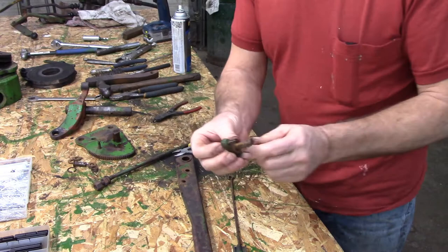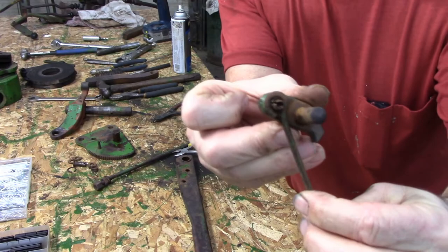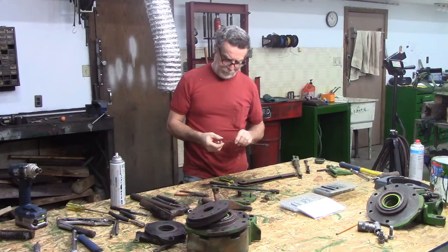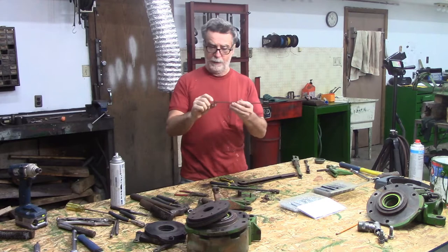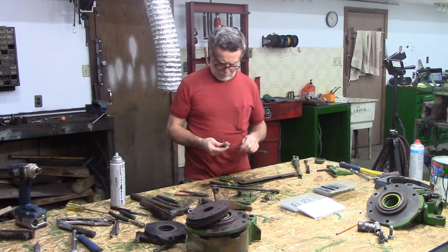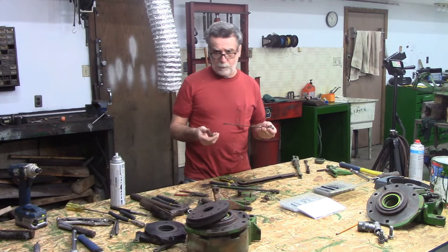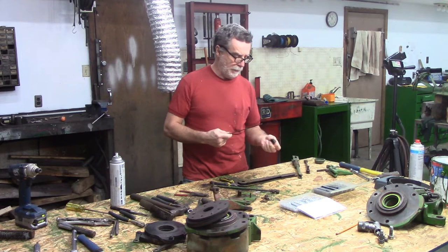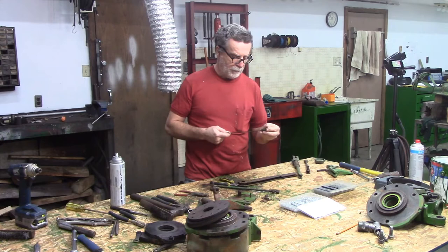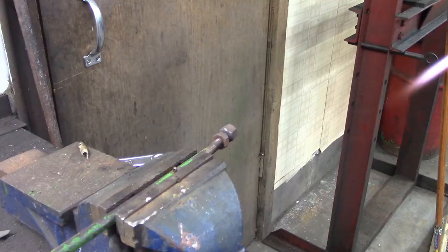Get rid of that washer. There's a roll pin there - you can see a substantial amount of wear and it's got quite a bit of slop. I was thinking initially I could just put it in the vise or take a pair of pliers and squeeze it down. Then I was looking at my various roll pins here - I'm reasonably certain I could find one that's going to work. But I'm also thinking I've got lots of different plastic pipe, and perhaps I can just find a little sleeve and put it on there. It would probably wear better than having metal on metal. And then for the rod end here, I think what I'm going to do is just put some epoxy in there and stop it from sliding in too far. But first we'll get this in the vise and get that threaded piece straightened. Let me rearrange these cameras and we'll get this job done.